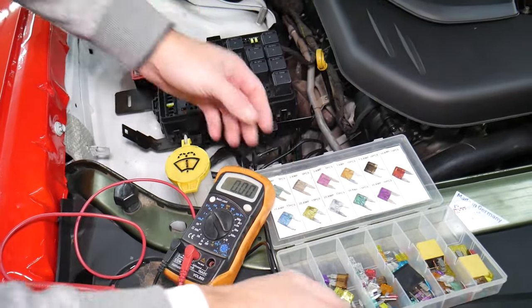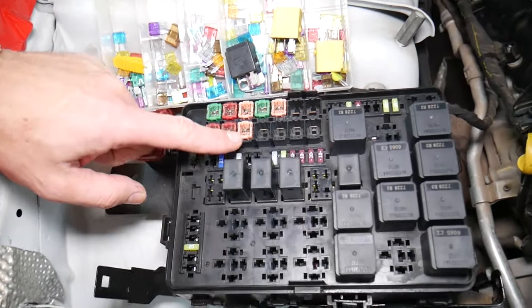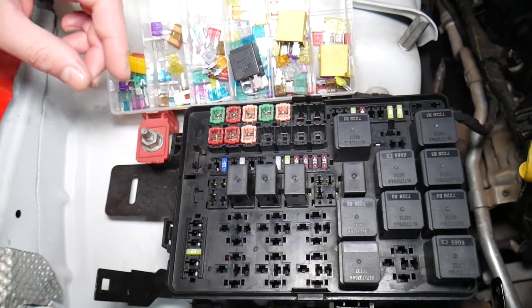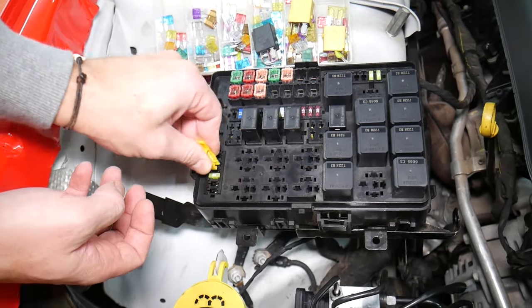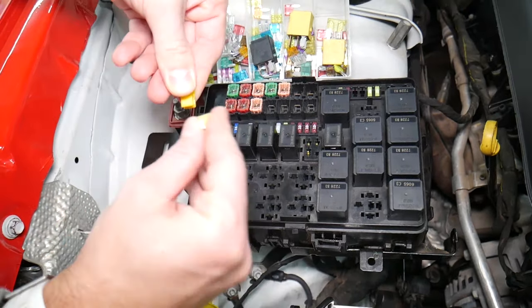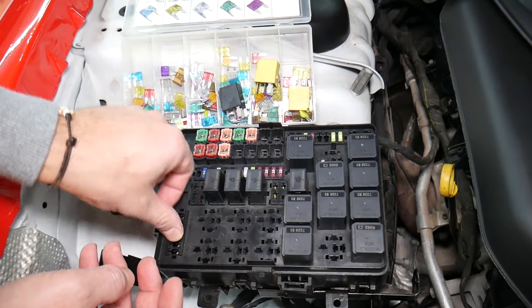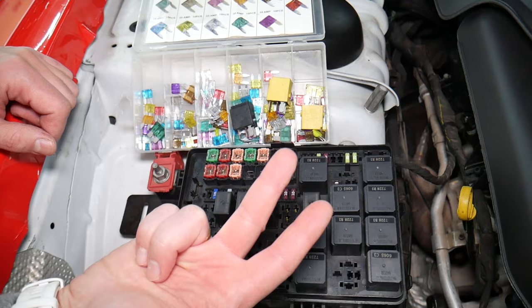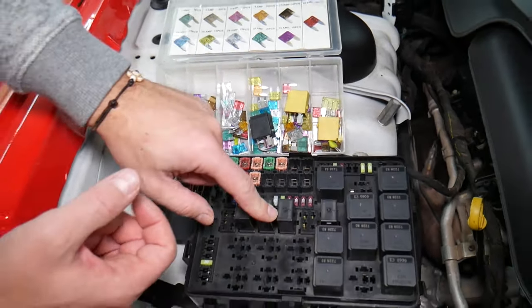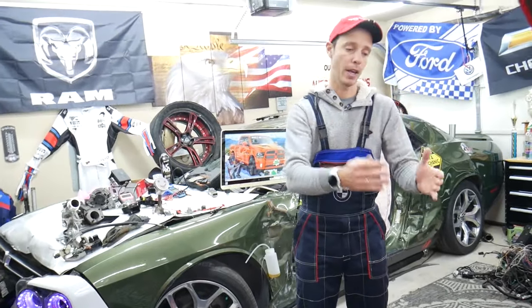Before we continue, let's explain quickly why it's always a good idea to test fuses and relays. It's very important because sometimes you may think you have a good fuse — it's hard to tell just by looking. I'll pull a 20 amp fuse right here — sometimes it's very unclear if that fuse is burned or not. You may not clearly see it. So always test them, because if you assume a fuse is good without testing, you'll end up spending money and time on diagnostics for problems that do not exist. We will put links in the description for videos on how to test a fuse and a relay.